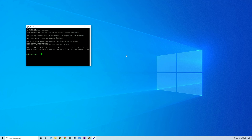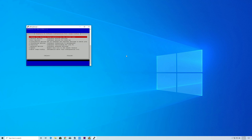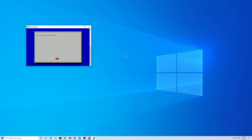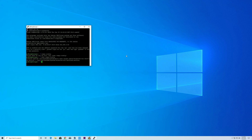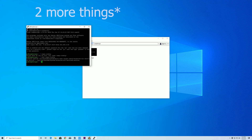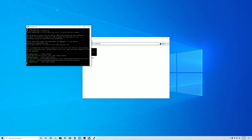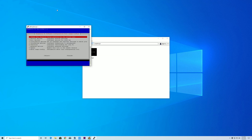Now we're connected via SSH. If you only wanted the Lite version of Raspbian Buster you're done, but we're going one step further to get the GUI via VNC. Type 'sudo raspi-config,' go to Interfacing Options, select VNC, and enable it. Then go to Boot Options and set B1 to Desktop so it boots straight to the desktop environment. Hit Finish and it'll apply the settings.